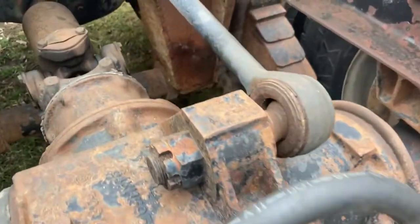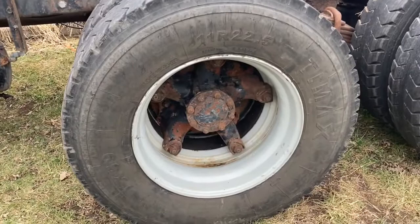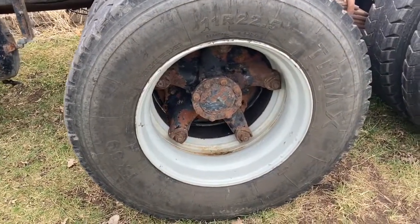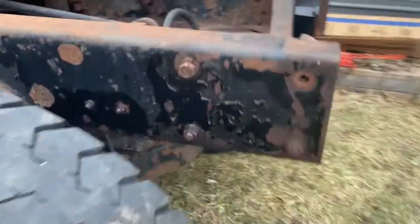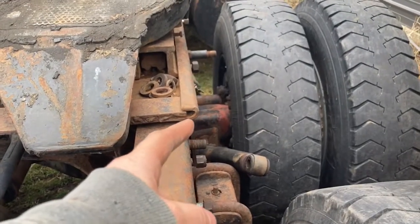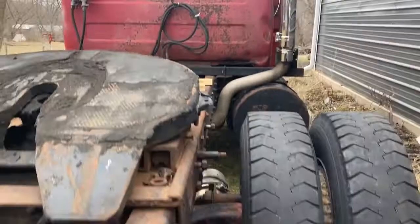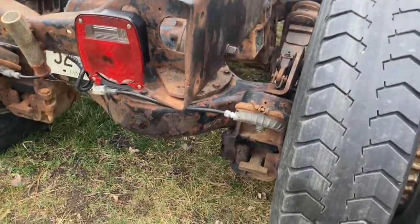I'm gonna put these two torque rods in — on the rear one you can see all the space in there. Basically everything in this whole rear end is shot, to put it simply. I'm also gonna put new brakes in there — new shoes, seals, etc. I'm gonna drain all the gear oil. This wheel up here I topped off last year and then I drove it somewhere and it's slung grease everywhere — you can still see it on the window up there. So that is the plan in the immediate future.